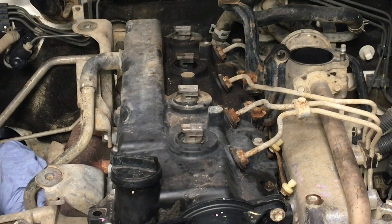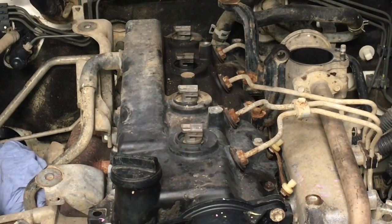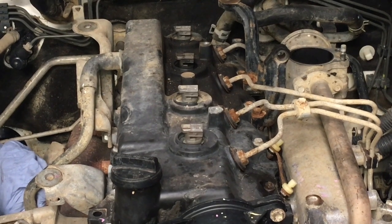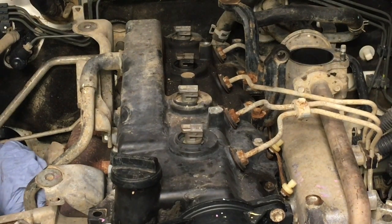We need to unplug the common rail, the plug on the common rail, okay? So that's at the front of the common rail, so we need to reach down near this pipe here, find the plug, usually best done with a light. I haven't got a light out yet, how's that, eh? So I'm working in the dark virtually, going by feel. You gotta find which side the little tab is to release the plug, which in this case is not found yet. It's at the top, I think. Is that the top? I'm pressing. Yep, and it just had a click noise, and I'm pulling the plug back. No, I'm going to need two hands. See, this is where they're a pain, and you can't get two hands in there. And the mud's stuck it on really well, but the plug's off. Job done.